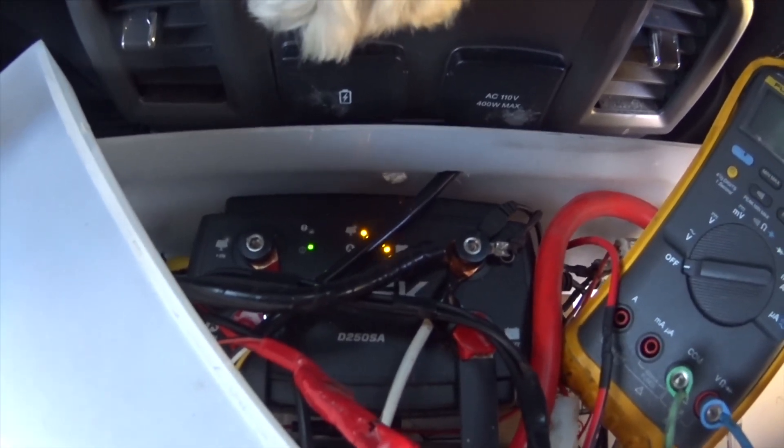See how it keeps flashing and it is a sunny day and the panel is in the sunlight. You can imagine the joy that I experienced when I realized that it was only a $1.40 diode. Everything else is still working. I'm super happy as I was previously confident with my layout, but then everybody throws that ten cents in — was the solar panel flexed under the roof? Was the wiring compromised due to the weather over the winter? Has it stretched, contracted, cracked inside? No, it has not. It's a diode. Going onto YouTube and Google after that, there's tons of problems with diodes. So please, if you have a problem, it could be a simple fix — just do a quick test and see if it's faulty.